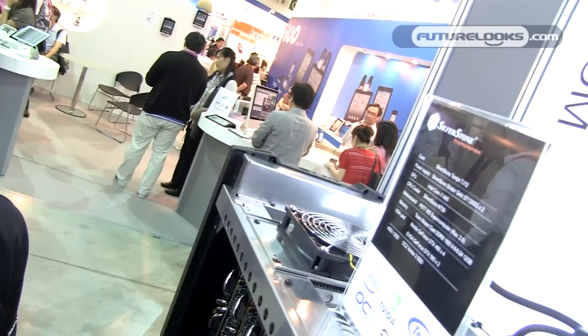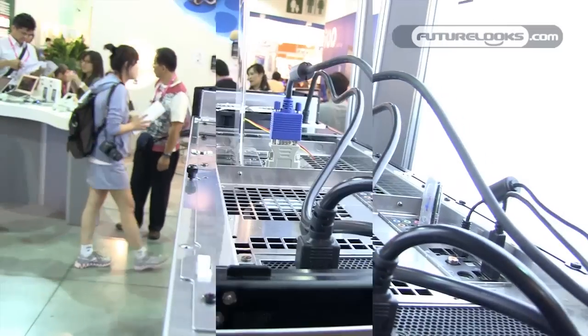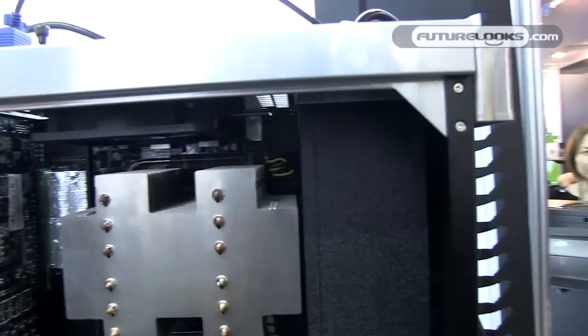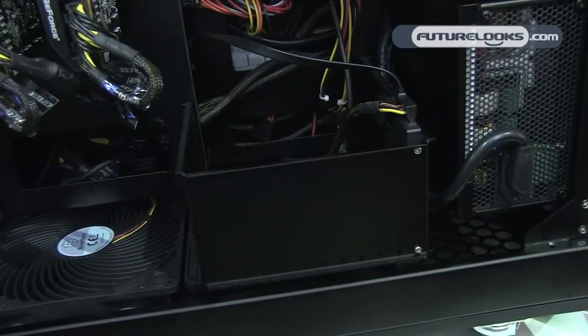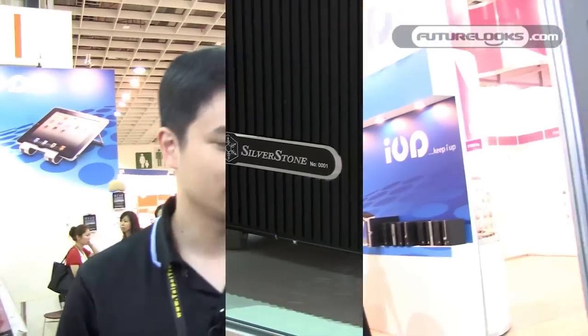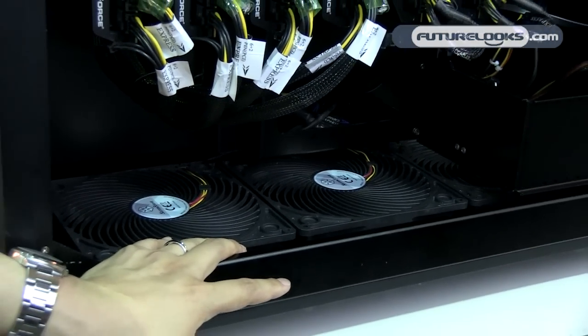With these graphics cards holding a lot of weight on top, the top panels are built of stainless steel with the rest of the chassis being aluminum. With so much potential power draw, we give you room for two power supplies on the rear, and an SSD drive cage that allows you to install up to 12 SSDs. Since this is a prototype, we still haven't finished testing everything, so some configurations may change by next year when it goes into production. Those three 180mm air penetrator fans can also be replaced by up to 8 or 10 120mm fans.